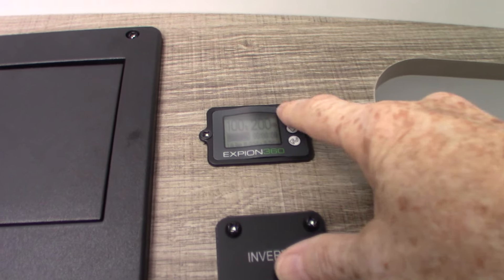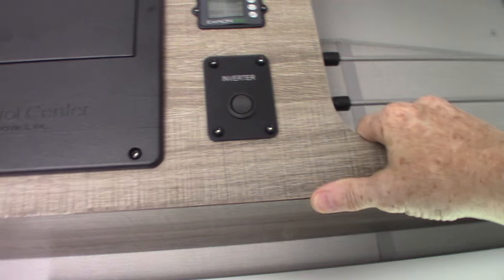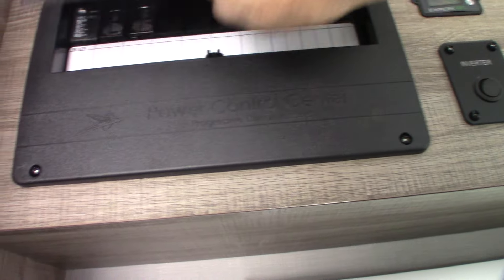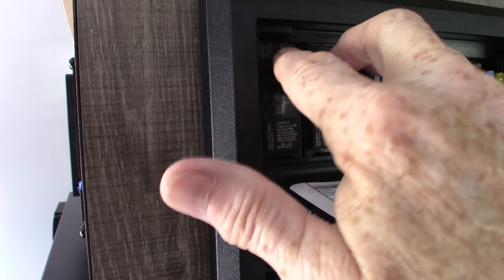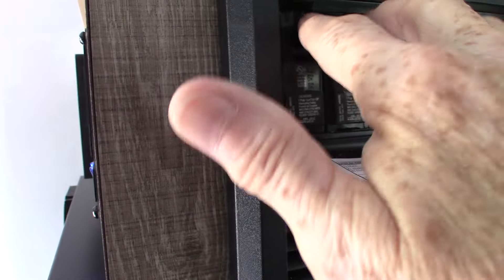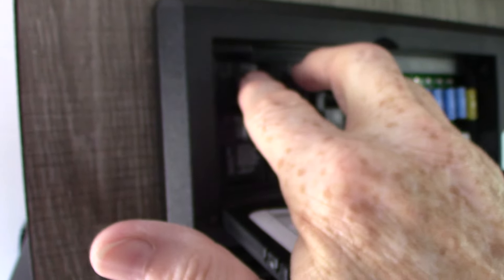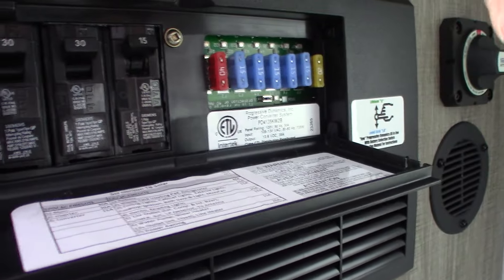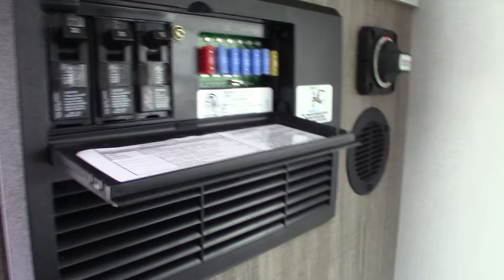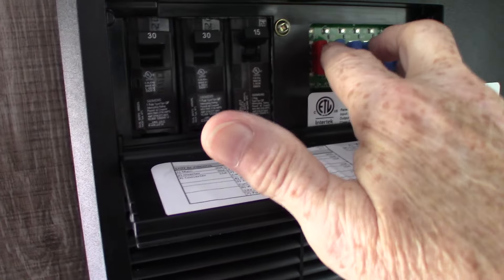You'll need to educate yourself a bit on the battery monitor — it's not difficult; it comes with paperwork, and their website has tons of good videos. This is your power control center, which has just a few breakers, and then you have your converter here. You have 110-volt AC at these breakers when you're plugged into shore power — just like circuit breakers at home. This distribution area sends AC power throughout the trailer where needed, and then it converts the rest to 12-volt DC. These are 12-volt DC fuses here and they're all labeled. This also senses how much energy your batteries need and sends 12-volt DC to charge them. So it's an AC distribution center, an AC-to-DC converter, and a battery charger all in one.